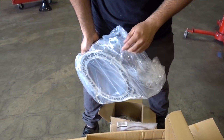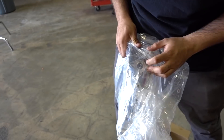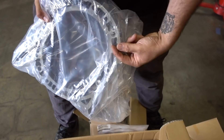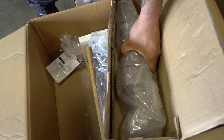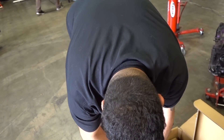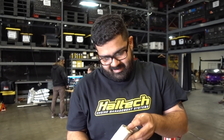We've got new housings for the build — these have to go out immediately to get machined. Machined for semi-peripheral porting. Right now this hole is shut, and they have to mill right through it and press in a sleeve to convert to semi-peripheral. That means we don't have to do bridge porting — it has a better idle and more power. There's also a new crank that's actually cheaper and lighter than any other year crank, and all this stuff is interchangeable across years, which is crazy.